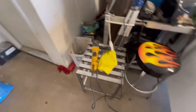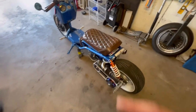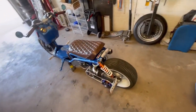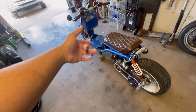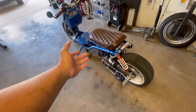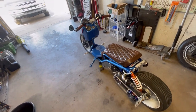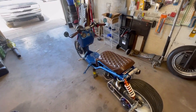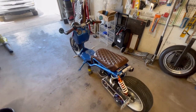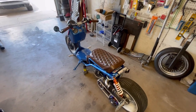I ordered Rolling Wrench's electric fuel pump because on decel there's no vacuum, so if I brake too quickly the vacuum fuel pump loses vacuum, there's no fuel, it cuts out, and then I'm stranded at a red light. Sometimes it doesn't crank over so I have to walk to the sidewalk - it's annoying. I'm gonna get an electric fuel pump to have constant fuel pressure at all times, so that'll be my next video.